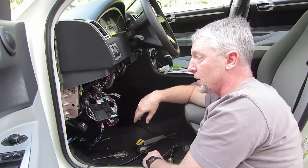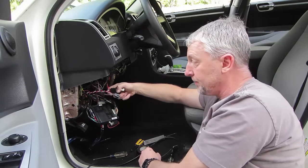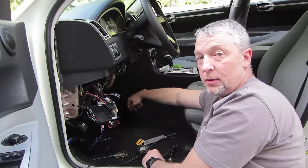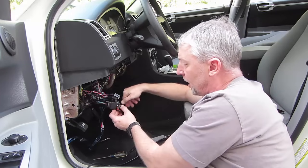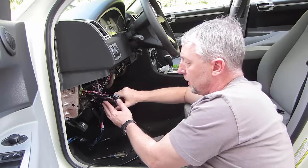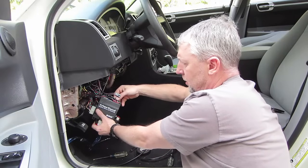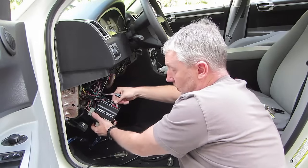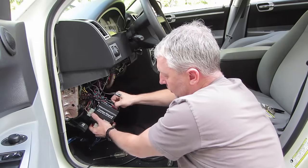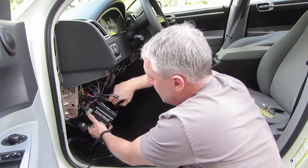So you never have to worry about anything. The only thing that can cause any problems would be a start or disable relay. I'm going to go into good detail on this because I'm never going to leave you hanging like that. That would be wrong. So this guy right here is just a battery backup. Over here you have two plugs, actually three. This one here is for a radar sensor or a motion sensor, and there's also a door lock plug. I'm just going to pull those right out.